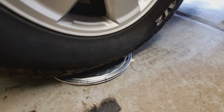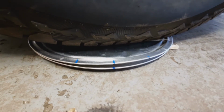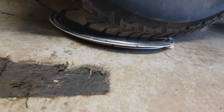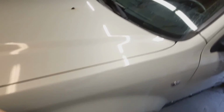All right, we're going to first turn the wheel to the left 20 degrees, which will make it line up with the mark on the left on my plates there. The whole plate's kind of moving. Yeah, it'll do that. A little more, right there. It's going to spring back a little bit. You're still overshot just a little bit. A little more. That's pretty good there. Alrighty. And then we can take our first camber measurement for the caster calculation.